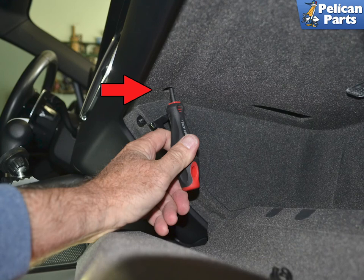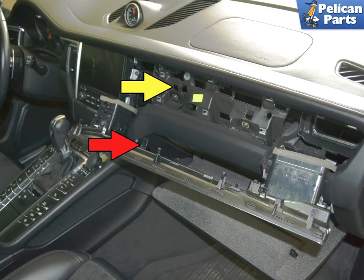There is a hook in the trim panel that locks into the dash. While most people get really frustrated trying to release this with a trim removal tool, there is a trick that isn't even in the shop manual. Take a screwdriver or similar tool and open the glove box. There is an access hole on the inside of the glove box — push the driver up into this hole and it will release the hook on the trim panel from the dash.